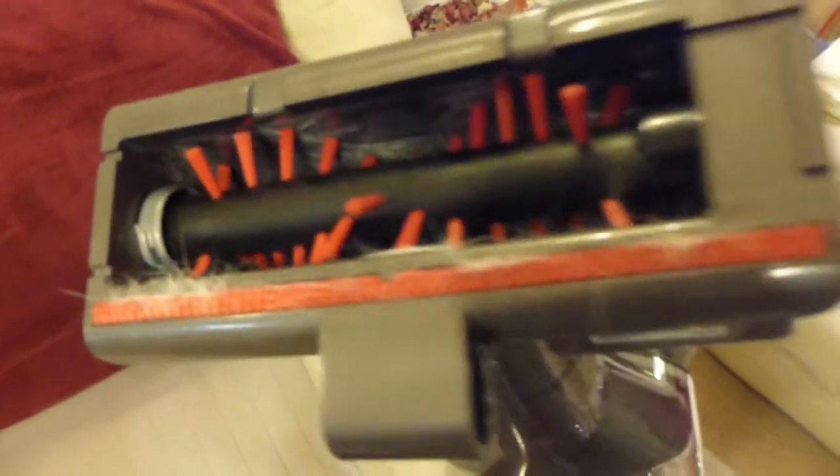See, what's happened to it is that some of them have got caught on the lint strip. So I need to just clear that lint strip off, okay? Just do that now. That is a little bit of a problem when you've got pet hairs everywhere. They do tend to get stuck on the lint pickers. And as soon as you turn it back on again, you've got the suction coming through.